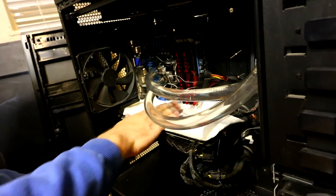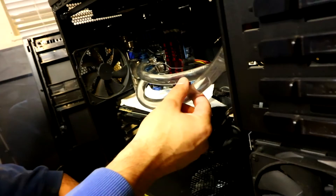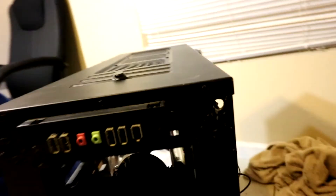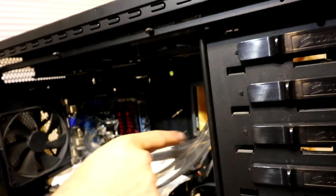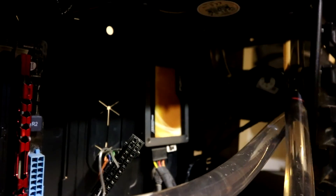You can see the water flowing right now and we have no leaks. You can look at the reservoir and notice it's full — you can even feel the pump running. I cleaned it all out. As you can see, it's that simple. You could probably do it much quicker; this is a very thorough job. You don't necessarily have to remove it — sometimes you can do it within the case. Just make sure you don't have any air bubbles, clean it as best you can, and don't strip any screws along the way. If you have any questions, comment below, don't forget to like and subscribe, and we'll see you on the next one.